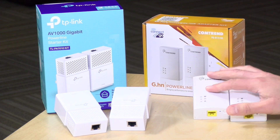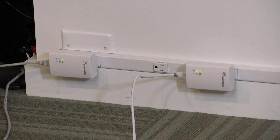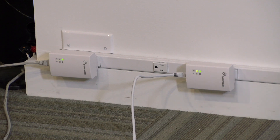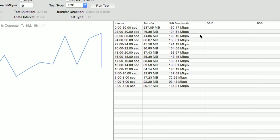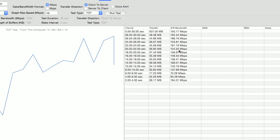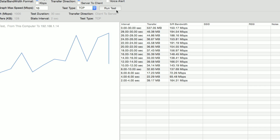Now let's see how these adapters perform in a perfect-world scenario where they're plugged into the same circuit, to see the maximum bandwidth. I retrieved the laptop from the bedroom and brought it right down here to plug it into the power strip. I have an alternating-circuit power strip, so I made sure to put both Comtrend devices on the same circuit for the most ideal test. The result was about 150 megabits per second — probably the most perfect environment we can get for these adapters. I'd love to hear if you've seen different results from these G.hn adapters, but that's what we ended up with in my testing.